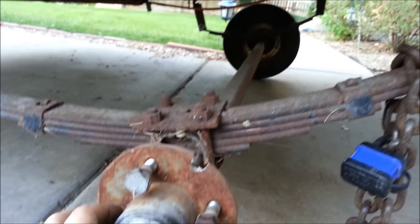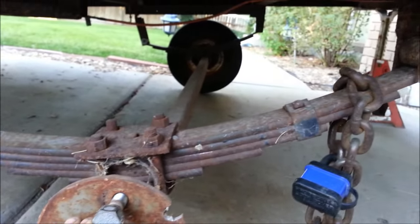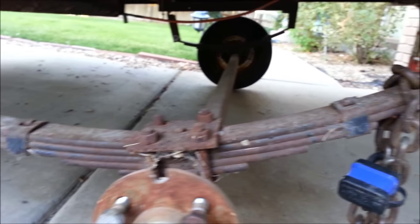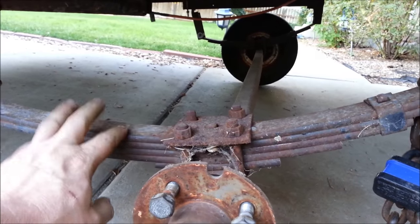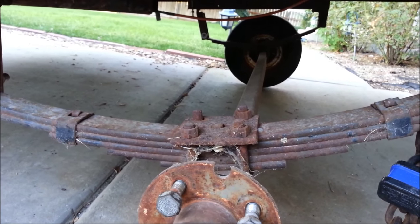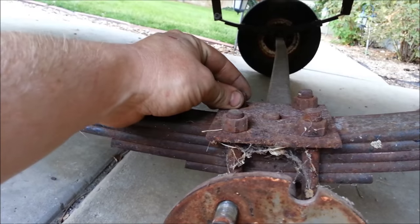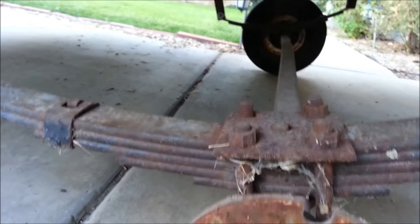With the tires off you can really get a better look under here. That doesn't sound good. But apparently somebody put way heavier duty springs than this trailer called for — that's not uncommon to see. These springs are the 1,750 to 3,500 pound springs, which are some of the cheapest out there, instead of the 1,000 or 1,500 pound springs this probably had originally. But apparently one of the bolts is missing — looks more like they just didn't put it on.